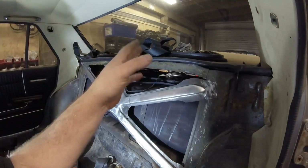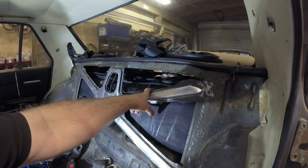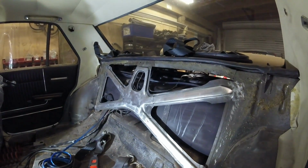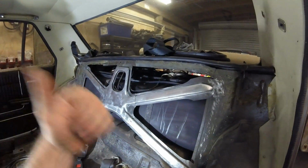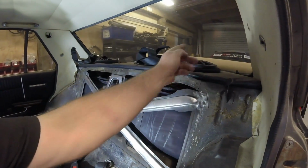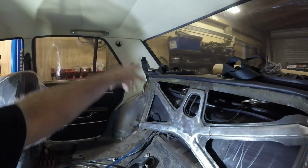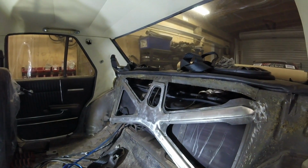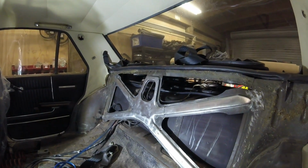So say someone manages to hit the back of the vehicle hard enough that they've absolutely stoved it right in and damaged the fuel tank and all that, you're not going to get a big gush of burning liquid into the cabin compartment. You'll never stop actual fire from this area into the cabin anyway. You'd really struggle with that, because there's things like speakers. Flames will just go through that in a matter of seconds, and flames will travel up through the inside of your pillars and all that sort of carry on. So I don't think they're trying to stop that. I think what they're trying to do is that initial thing where we don't have burning fluids coming in here, and then you can get out of the car and you're not on fire while that's happening.